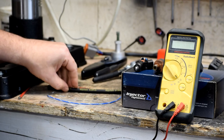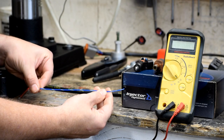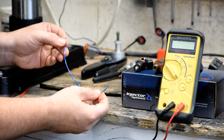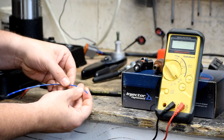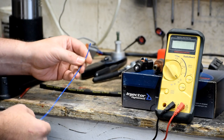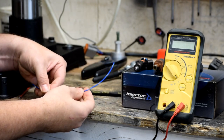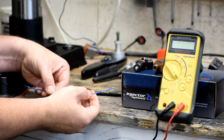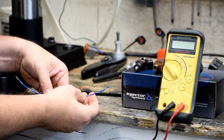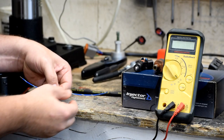We're going to recreate this harness with new connectors using newer technology. The first thing is this wire — it's called Tefzel wire. This is aircraft wire, also used in high-end race cars, Formula One, things like that. The magic behind Tefzel is first that it's got a very thin but extremely strong insulation — the insulation thickness is maybe a third of standard automotive wire. It still comes in a bunch of different colors so you can maintain the OEM color code. Because it's thinner, you can pack more wire into a similar space.